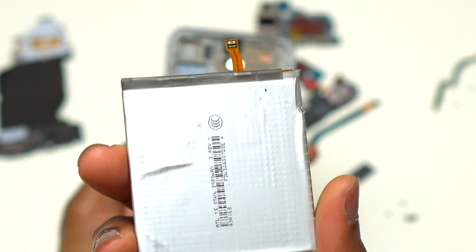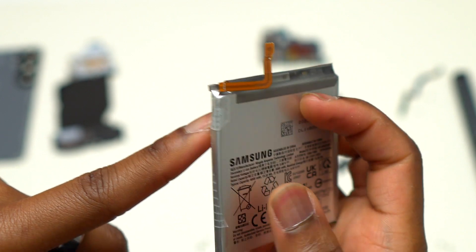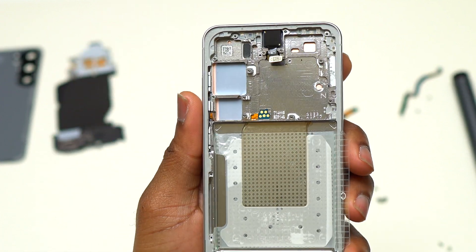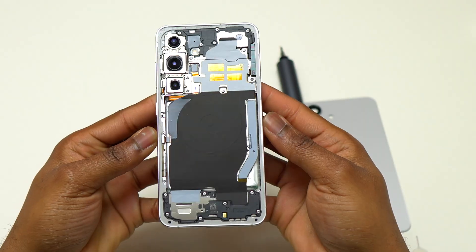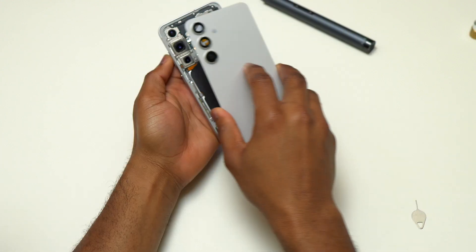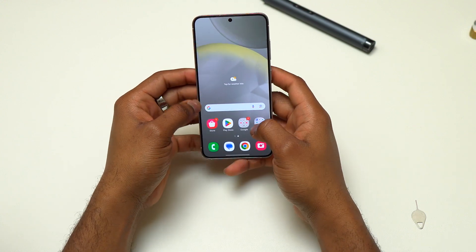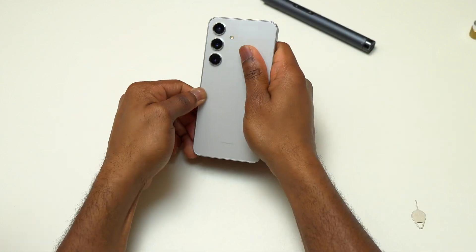Here is the battery of the Galaxy S24 — it is perfectly fine. There will be a slight bend on the battery whenever you pull it out, even using the pull tabs. With Samsung Galaxy devices you do not need to worry about battery compatibility; the replacement battery will work directly with any motherboard. If you have new double-sided tape, you can reuse the back glass as long as it is not broken. You may also use B7000 adhesive if the original double-sided tape on the back cover is unusable. Subscribe, like, and share, and I'll see you in the next video.